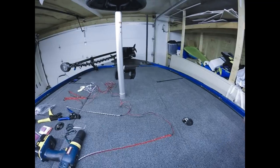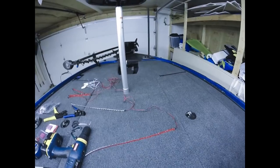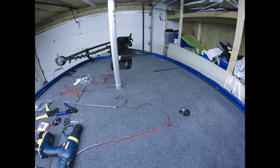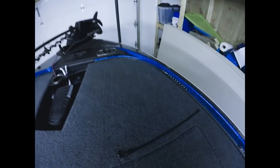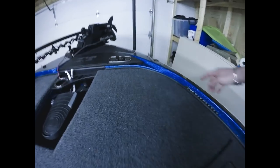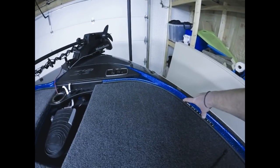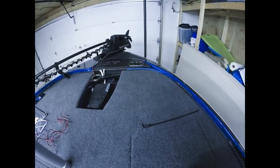The biggest tip to remember is that before you do any kind of drilling, the first thing you want to do is lay the lights out on the deck and decide where you want to place them. Then the next step is the drilling, of course. What I did on the front deck, too, is I started in the front. To make sure they're even, you want to pick a starting point and use your tape measure. I measured from the light to the very first spot where I drilled on both sides, just to make sure they're dead on and accurate as far as spacing.